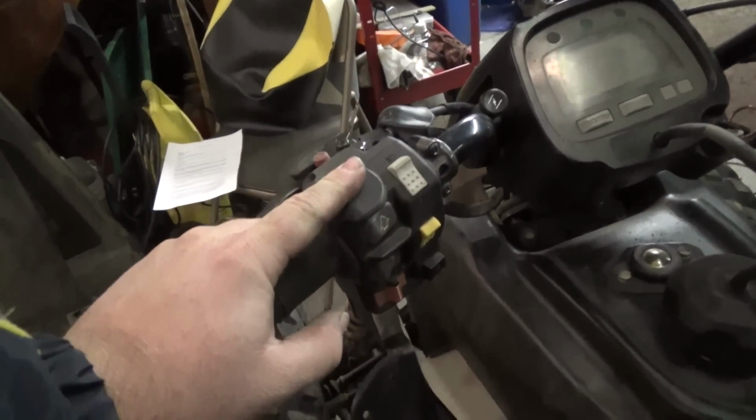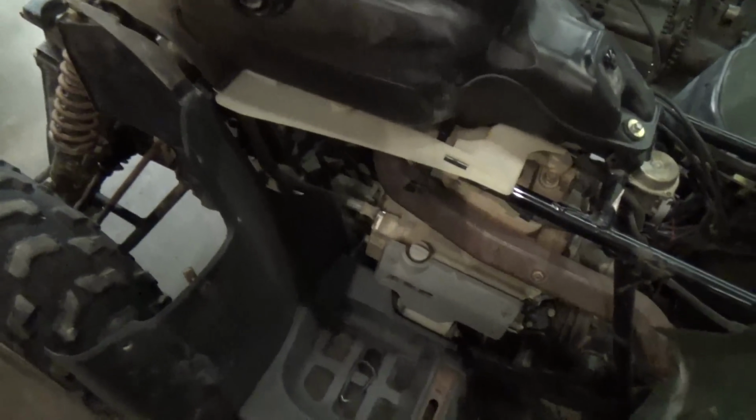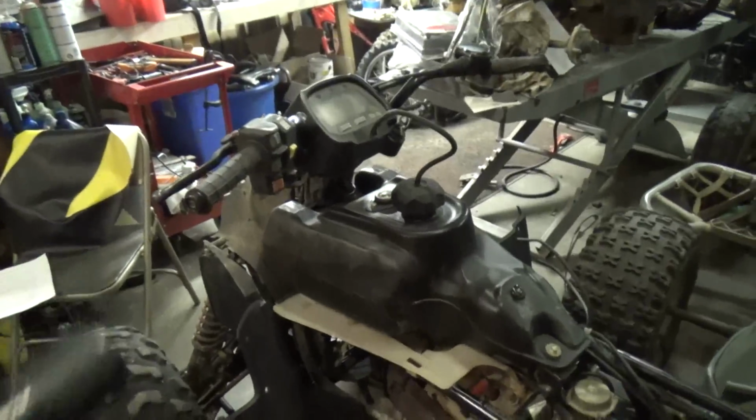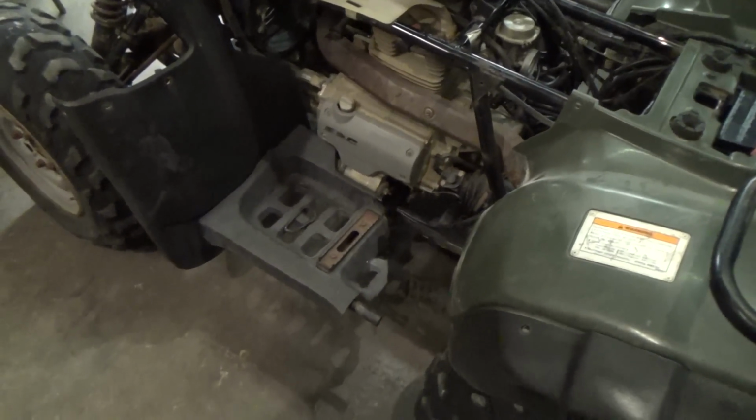the controls here, the controls, you've got the ECU, which is the computer back there, you've got the reverse sensor, which I just showed you, which is underneath the boot. You also got, going in by the pull start, you've got a gear select sensor, which tells the dash what gear it's in. You've got the shift motor down here, and just below it you've got the angle sensor. Those are pretty much most of the parts for the electric shift.